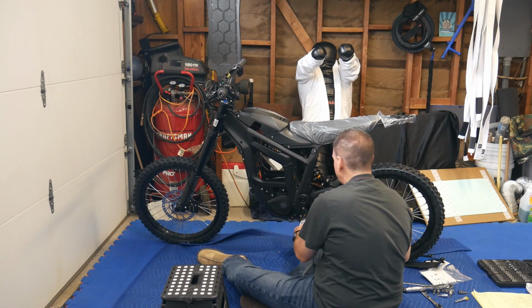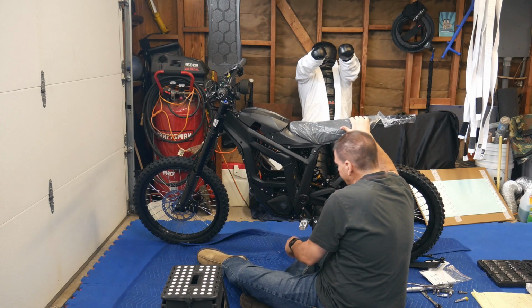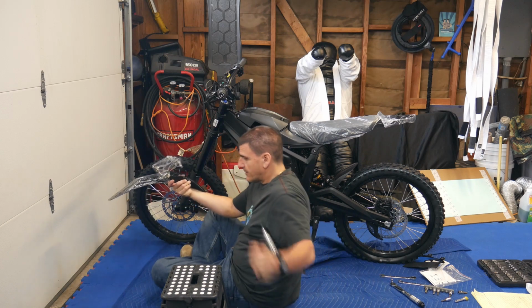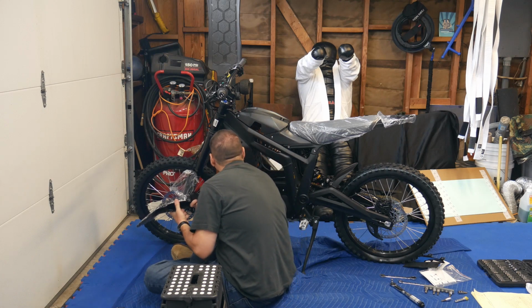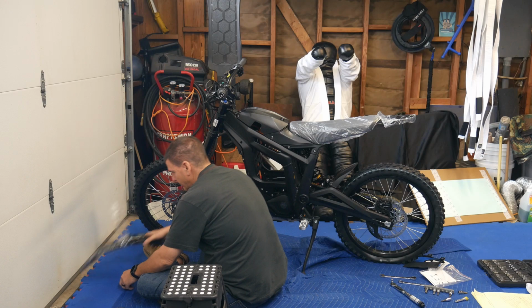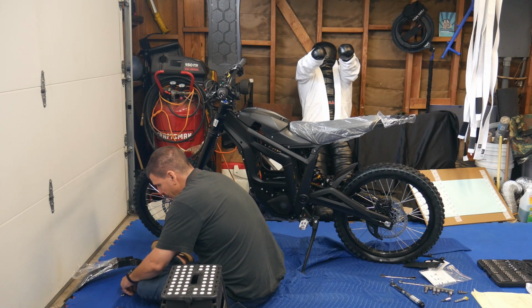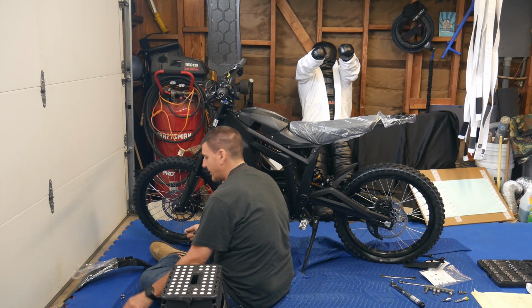sensor. I don't know if you guys can see from there, but they fall back when you fall. So the fender, obviously, long part goes that way, faces up. There's going to be 3 holes down here. Get my screws and washers ready. And then same thing, you want to put these in by hand first. You don't want to just crank them down.